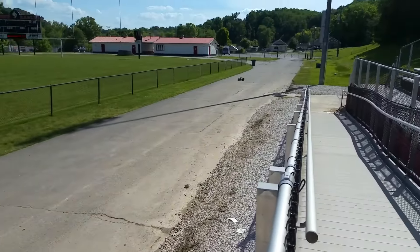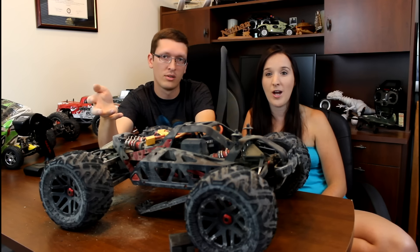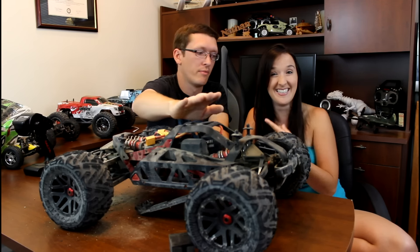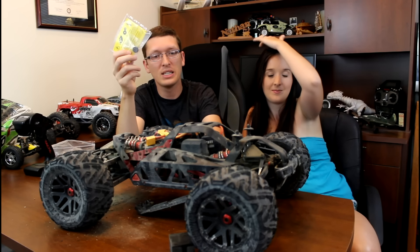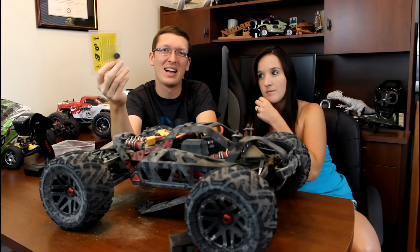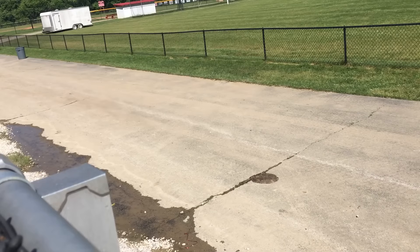The motor in this is a massive 2000KV brushless motor providing tons of power. We got ours to go 53.44 miles per hour (86 km/h) right out of the box. They claim you can go 60 miles per hour — I believe you can, but not right out of the box. It comes with a 15T pinion gear installed, and you do get a 17T pinion gear in the bag of goodies. The 15T is recommended for off-roading; the 17T will give you higher speeds. Unless you're at a NASCAR racetrack and really want that extra five miles per hour, just hold on to your 17T and have fun — this thing is crazy fast.